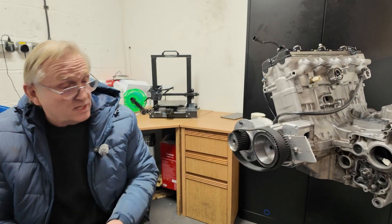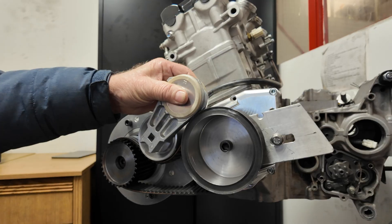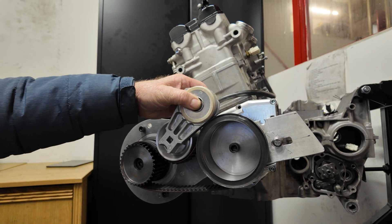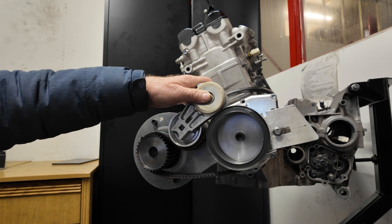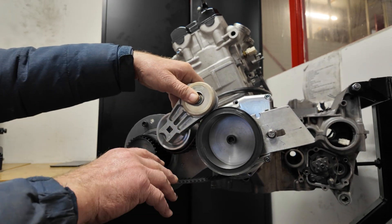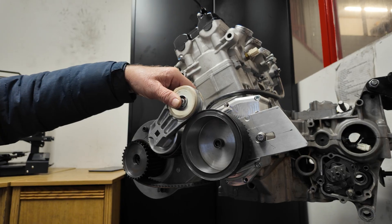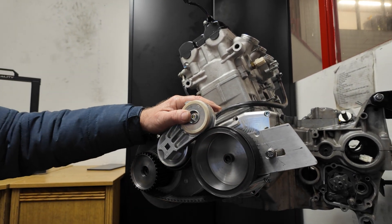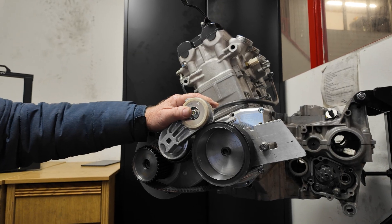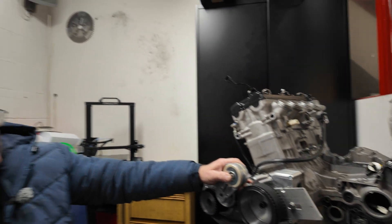This mock-up was knocked together just to get a feel for where we needed it to be. We're running an auto tensioner — the tensioner is going to sit here — and this will take the shock loading out of the drivetrain and help keep things together in this extreme application. It'll bounce up and down if you hit the rev limiter, hopefully stopping broken input shafts to the supercharger or drive shafts from the engine.